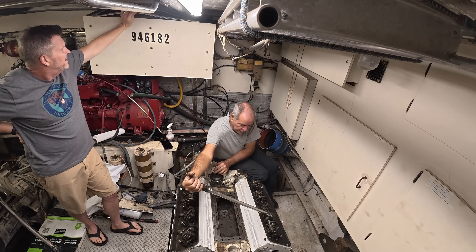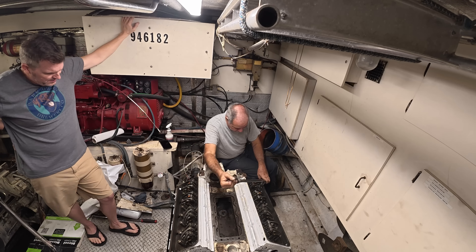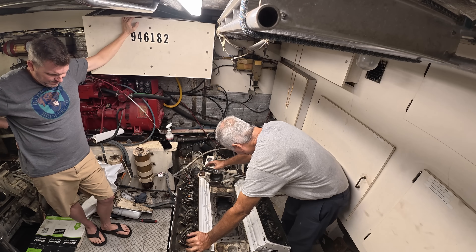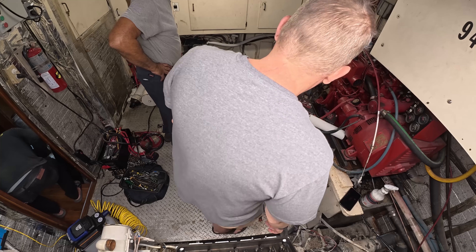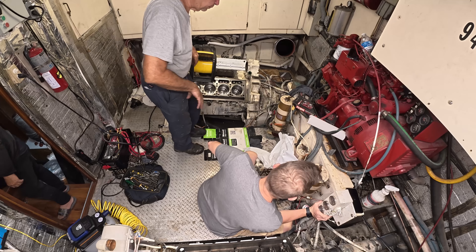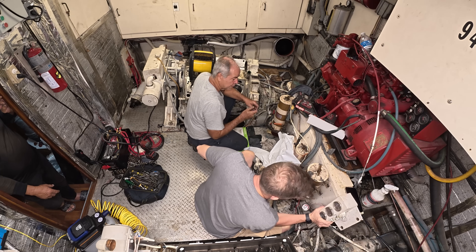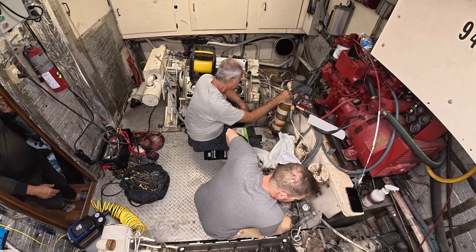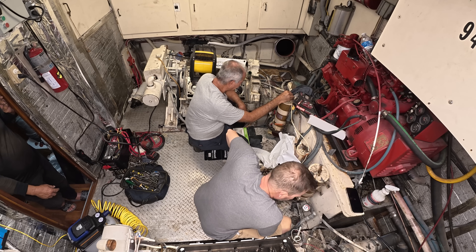So where are you trying to get to today before you leave? Well, I'm going to leave these heads torqued, then bring everything that's upstairs downstairs. I'm not going to put any manifolds or anything on today, because I've got to take some pictures of where this thing goes assembled so I can get all the hoses and everything we need. I wouldn't mount these right here - I'm going to put a camera on that wall, and we're dealing with short runs, so just three gauges. It's not on top of the engine - those gauges get vibration and heat.